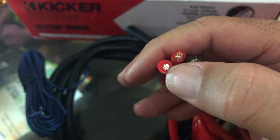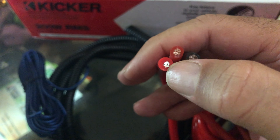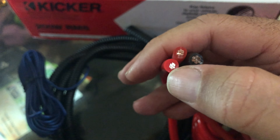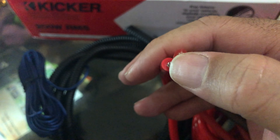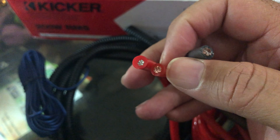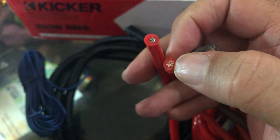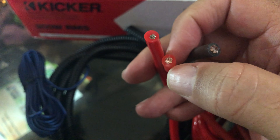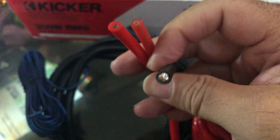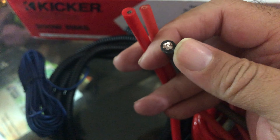I've seen an example — this is what actually got me to research it. A guy had this cable melt. It melted the carpet in the car. It didn't catch fire, but it actually melted and made a mess in the back of his trunk. This is the copper from the Crutchfield kit — it is actually a 10-gauge as it's supposed to be, and this is the actual 8-gauge wiring I used. It is really 8-gauge.